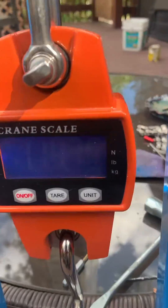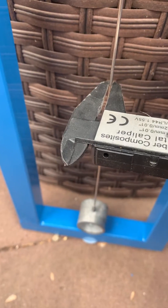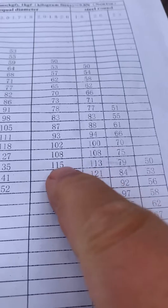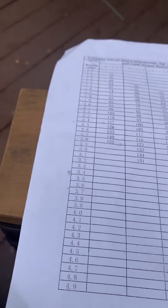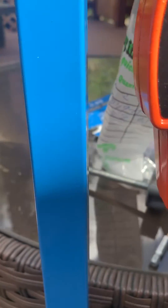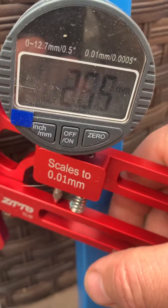This is the video you guys requested. We have 115 kilos. The spoke size is 2.0, in the middle it's 1.8. At 115 kilos in your chart, it should be a deflection of 3 millimeters. But look at the tension meter — it's even less than 15. We get 2.6, 2.5.